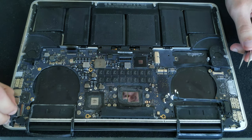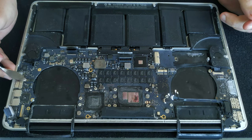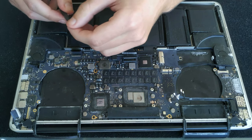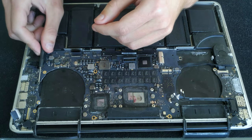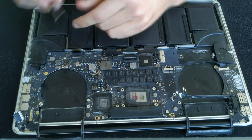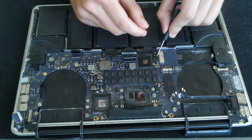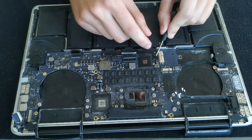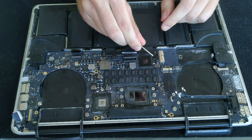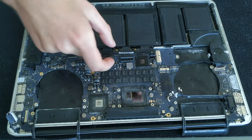After that you can bend the connector a little bit so it doesn't get in your way when you take the logic board out. The microphone cable is the same type as a fan cable — lift the arm up before pulling the cable out of the housing. There is not much space so be really careful. Now disconnect the second speaker — the connector is the same as for the first speaker, so use a sharp flat head screwdriver to lift it up.